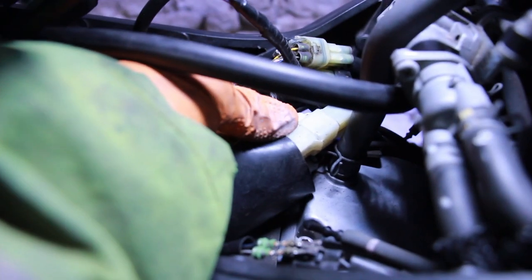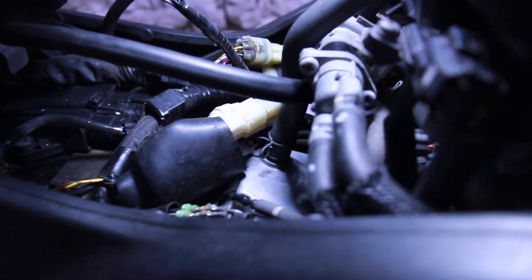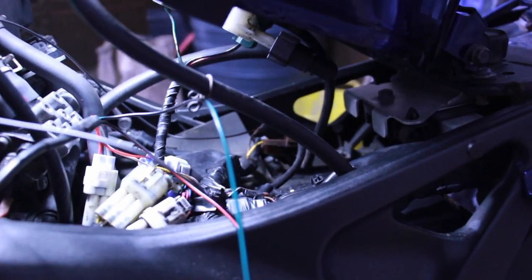It looks a bit green though, and that's my concern. I'm gonna have to do this two-handed, and let's plug in the sensor, the machine. Okay, so we're going to do the same thing with the power. The pin for the rear brake light switch there is the same as the spare pins I have. That's a switch live, and there's obviously not a great amount of current for this little LED computer to be lighting up, so that's what we're going to use, and that's what it recommends in the instructions.